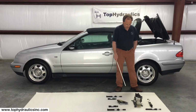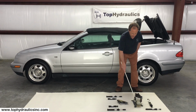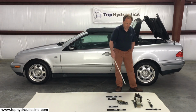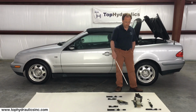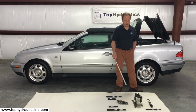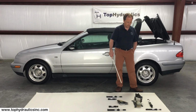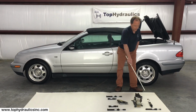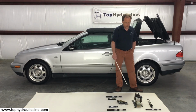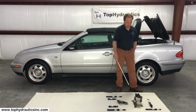What can go wrong on the pump? Well, there are several components to it. There are, as I said earlier, the solenoids, the electric motor, and of course the pump mechanism itself. The pump mechanism can wear out with time if there was a lot of sludge in the hydraulic fluid. Sludge develops simply from decaying seals in the rest of the system, mostly, or slight abrasions from the cylinder walls. Once your fluid gets really dark, you know you have sludge in there. That is a little rough on the pump if you use the top a lot.